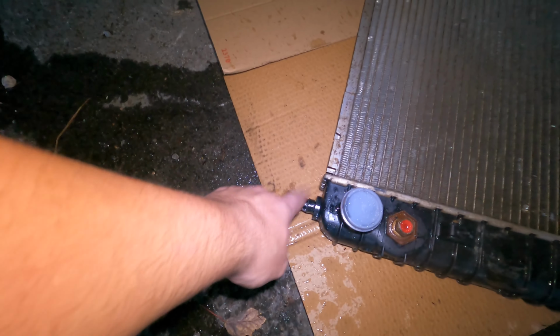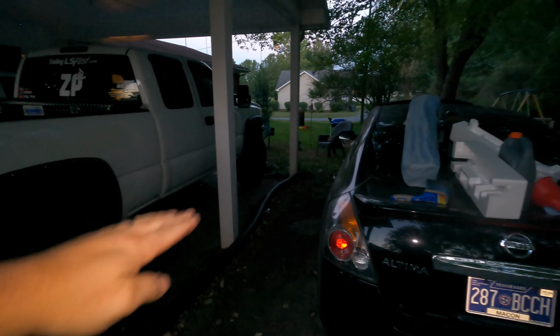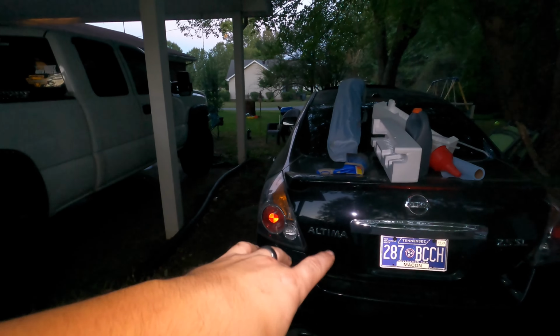And then the two bushings on the bottom, you have to swap those over as well. Mine, one of the bushings came out, one of them stayed in the truck, so I hurried up and swapped those over. There are two holes in the very bottom right next to each other. So this radiator, if it's 28, will be sitting on the inside. And since we upgraded to the 34 inch, it's got to go to the outside. So if it's still in the truck, the hole that's here just has to get transferred over to the hole that's on the outside.